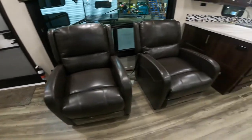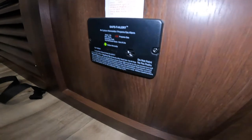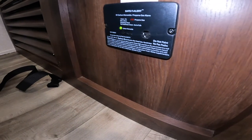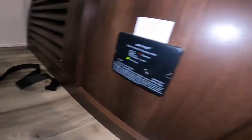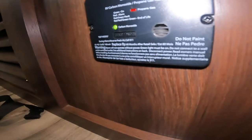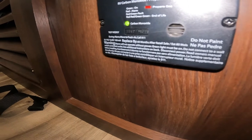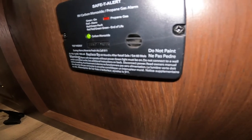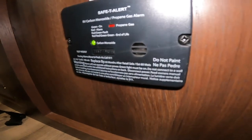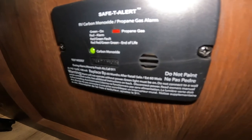Turning around, we'll see the additional seating, and we'll come to another important piece of safety equipment — that is your carbon monoxide and propane detector. If at any time this goes off, that could mean you have some carbon monoxide or gas in the trailer. You may get it from paint or painting, or if your doors are open and gases are leaking in from a nearby vehicle. It is important to test these — I usually suggest every six months, which lines up with the standard for your smoke detector and is easy to remember at daylight savings time.